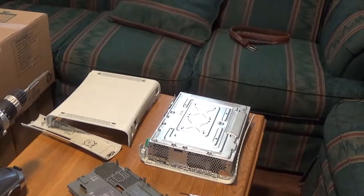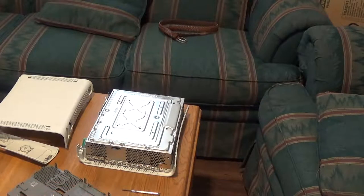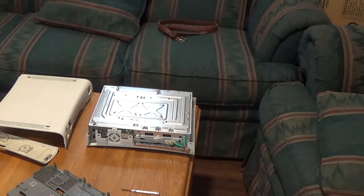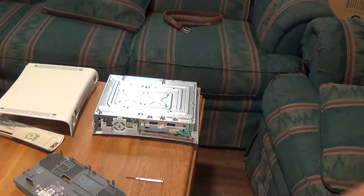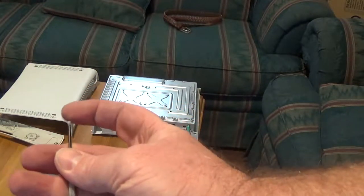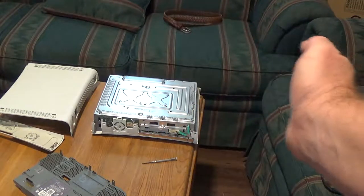Finally got the top off. One thing that might help is to figure out which side is attached to the Xbox - put your disc drive on the bottom and that'll make the part that comes off on top. Another trick: make sure your flathead screwdriver is perfectly horizontal, the flat part not twisted at all. For me the hardest part was applying pressure while pushing the buttons, and it seemed to work best if I started at one end and worked my way to the other.